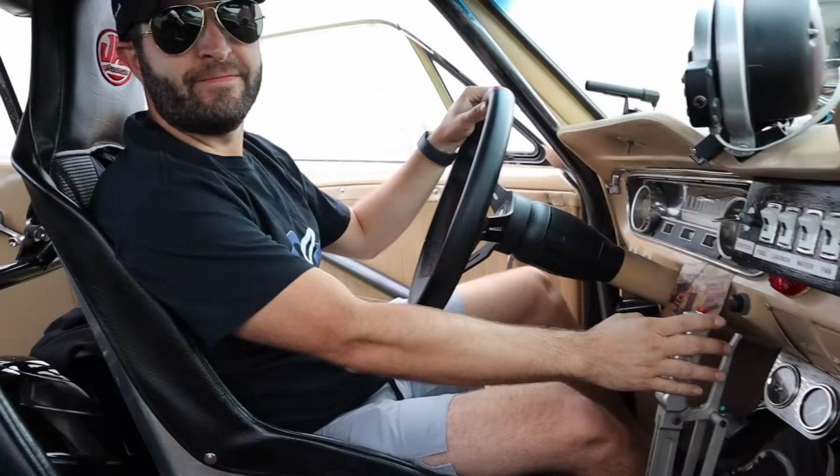So Bobby, stock, super stock stick cars, one of the most important components is the clutch. What are you running for a clutch? We run a McLeod soft lock clutch, single disc, 10.5-inch diameter. So we're a little behind the times. Many people are switching to smaller discs, dual discs, and we're kind of old school, using the old school equipment. It works for us, so we don't really want to change anything.